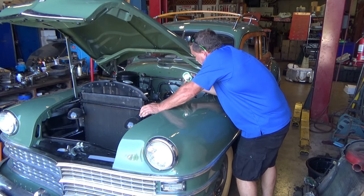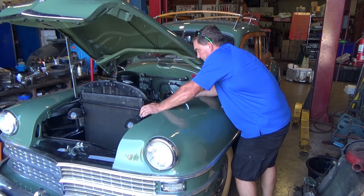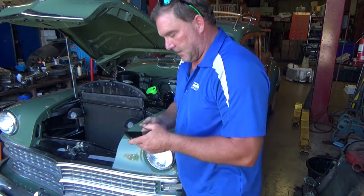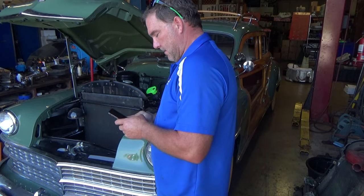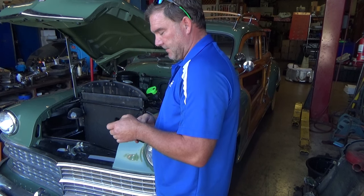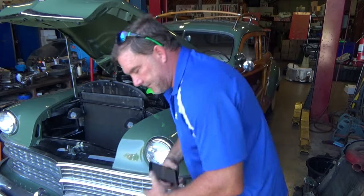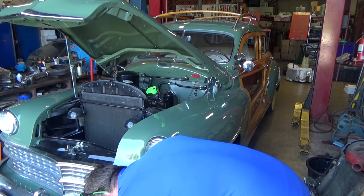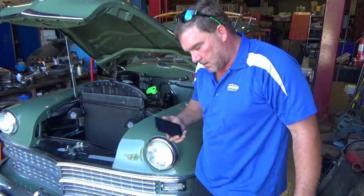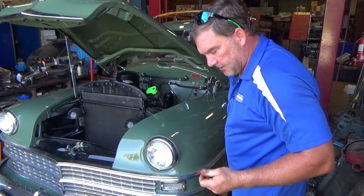Why did they take the bolts out of the battery? That's odd. Ooh, is this a positive ground vehicle or a negative ground vehicle? That's a question. Please hold. I need to look something up. Did I see a manual in the back of this car? So you have a big one and a little one. Okay, so negative's the little one. This is a negative ground car. Good to know. At least that's what we're going with, because of what the battery terminals will hook up to.